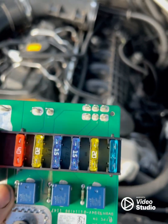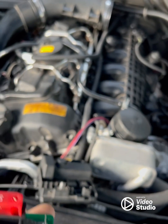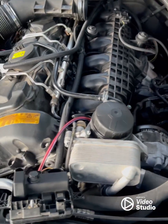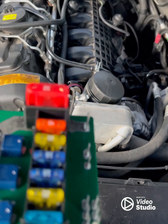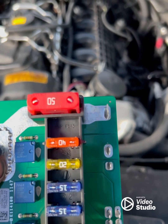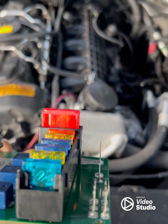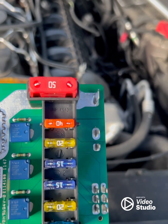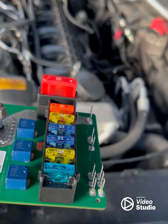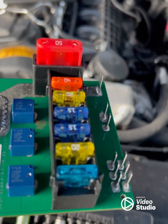This module is the main power supply to the DME — if one of its internal fuses is bad, your car may not start. I checked the whole wiring harness going to the DME but couldn't find anything there. Finally I figured out this was the problem. Hopefully this video saves you a lot of money. The codes 3719 and 2A60 pointing to fuel injectors and coils — this supply module was the main cause.